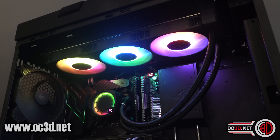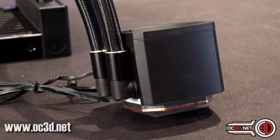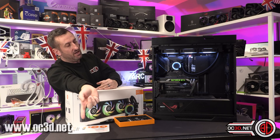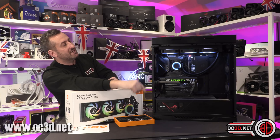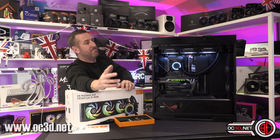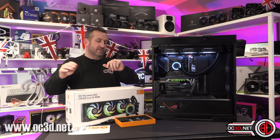Down the side of the pump, the fittings are completely rotational — you can literally spin them around a million ways. They have lovely little aluminium ends with a nice bit of machining touch on them, and the braid is very nice. There's a fair amount of hosing too. I've got it in a big Helios but you'd cope with a bigger case. If your cables don't stretch enough, just turn the radiator around the other way — it looks the same both ways — and have the hoses at the back end of your case.